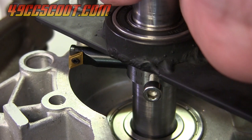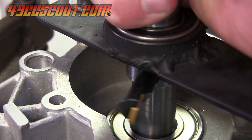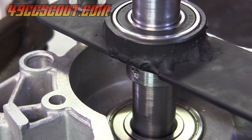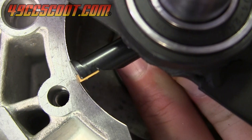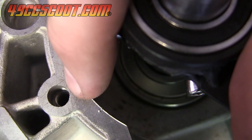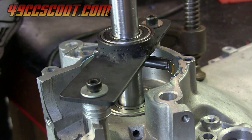Normally, you'd have some crankcase ID to shoot for, and you would work toward that in steps. In this instance, I just wanted to find out if the tool actually worked, and I wanted to push it a bit to stress it, rather than taking a small bite. I set the cutter up to take off around 25 thousandths of an inch, which actually cuts double that from the total diameter, so I was attempting to cut more than a millimeter off on the first pass. I added some oil to the cutter and cases and started off to find out if the tool was a success or a failure.